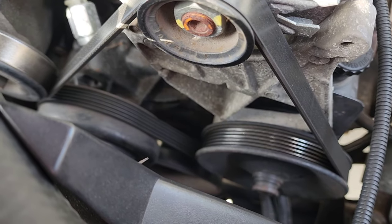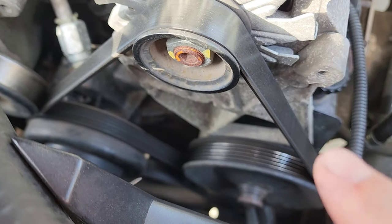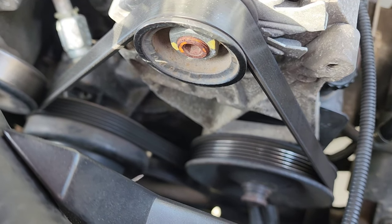So I was able to get it in and get it set up, but it still wasn't timed properly because it was all out of whack. Again, this distributor had never been changed on this vehicle. I was looking for a white line down here on the harmonic balancer when I was using the timing light, and I couldn't find it because it hadn't been marked. So because I didn't set it to top dead center before I pulled the distributor and didn't put the distributor in time to where you could adjust it side to side just a little bit, everything's completely out of whack.